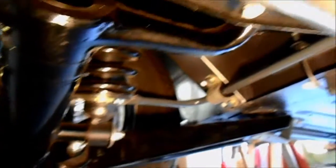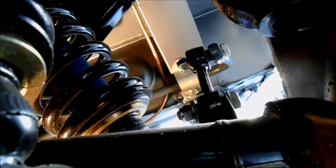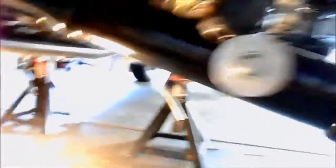Here's a little tour of the bottom of the car — things are looking good. I loosened up my anti-sway bar link nuts and bushing bolts because if those are tight when the car is in the air and then you set it down, you're gonna be twisting the bushings, which is not good for them. You want them in the relaxed position when you finally crank them up tight — so that's what I did.